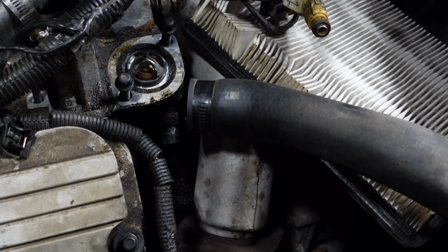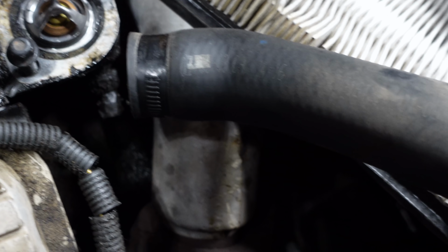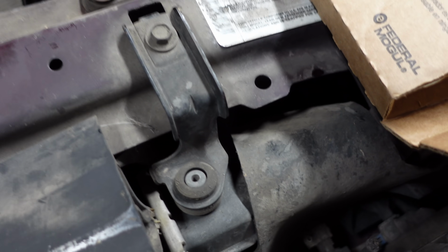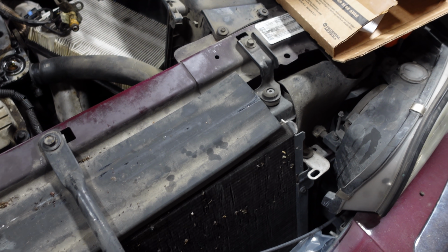You know how I can tell that this radiator hose works out? Because it's really swole. What isn't swole is the location of the other end of it, which is deep down in there with a stinking constant tension nonsense. So these brackets come off with a 10. Those brackets are going to come off with a 10. The radiator is going to tilt forward a little bit, and hopefully I can actually get to the stupid thing. Okay, well, turns out that was all mostly superfluous.